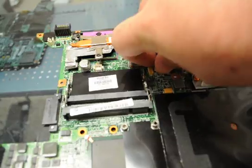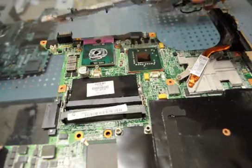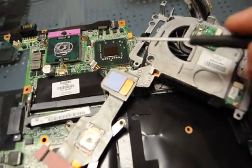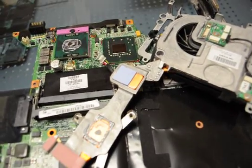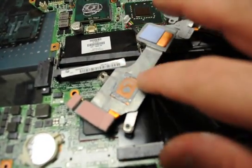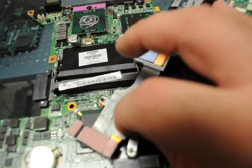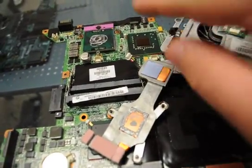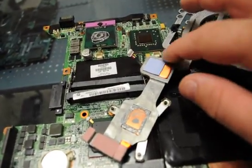What we're finding is that aluminum heat sink is not actually working. As we reveal here, this is the same TIM material that we just put on that previous system. And if you can't tell, this is old hard concrete thermal compound right here — and that's what it looks like. As we've seen with the other system, that wasn't taken off, that wasn't taken off, and this right here was actually replaced.